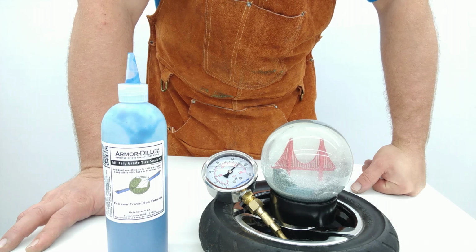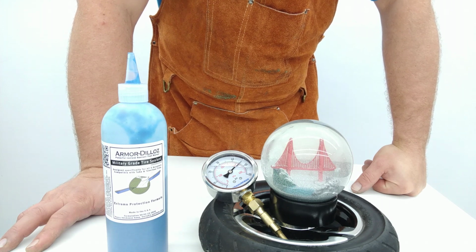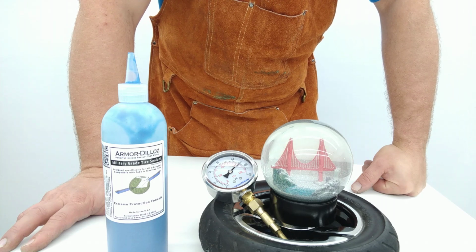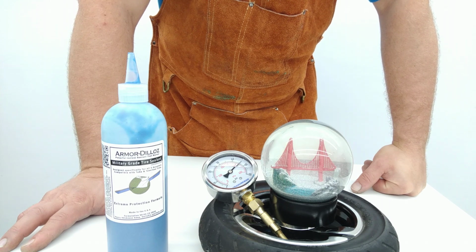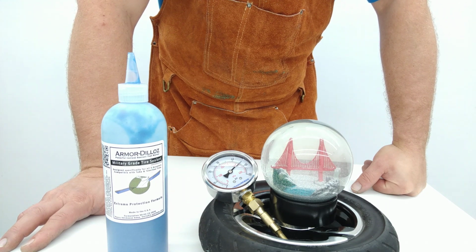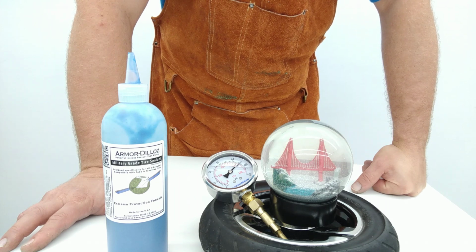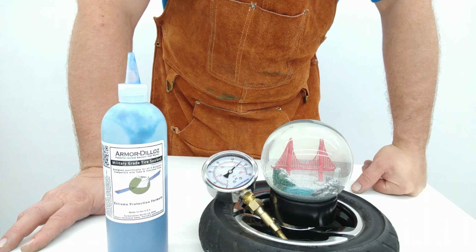This is an inner tube type tire, so this is not a tubeless, which are much easier to deal with. While we'll rate this easily to over 1/4 inch in a tubeless, unfortunately I can't get anything that large into this tire, so we're having a little difficulty testing it right here on camera. But needless to say, a 16 penny nail sized awl, which is what we're using here to puncture it, clearly allows you to get a pretty fast seal, and as you see, we've not continued to lose PSI or have any leaks afterwards, so even fairly serious punctures are really not a problem to deal with.